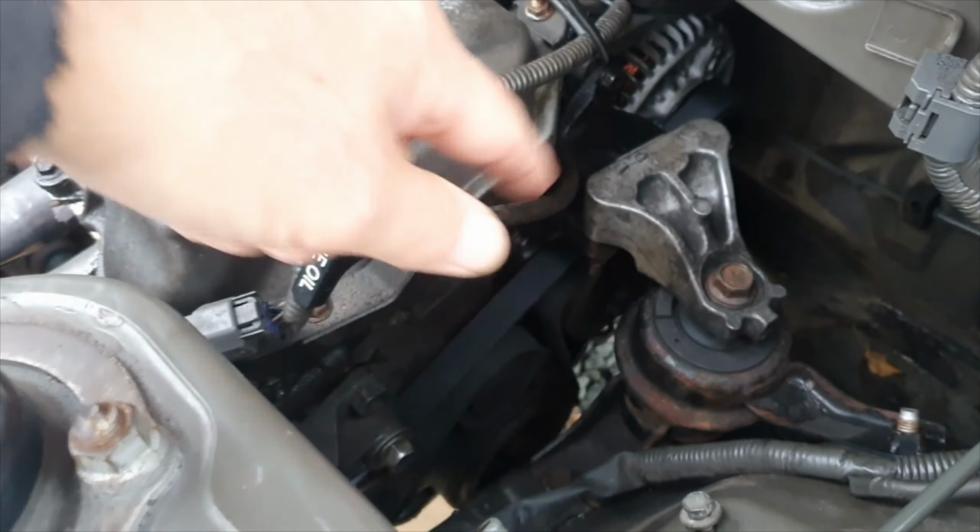If you try and do it any other way, it's so twisted down the bottom there, you can see how that belt is going around the crank pulley and then around the tensioner here. It's like a bloody snake. In any event, she's on, so just need to tighten up that bolt down the bottom there and get the battery back on it, and the job is a good one. Kaboosh.